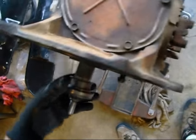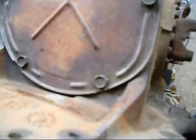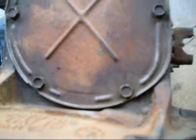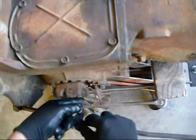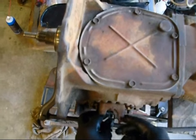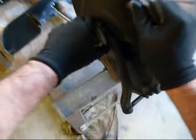So what we're gonna do, put that thing on there like that, and we're gonna line it up. You gotta kinda get tricky with it and push the spring thing in with both fingers. And we missed one, because I got gloves on. There we go. Okay, we've got both our spring fingers down inside the throw-out bearing. Got our little guy on there like that. I'm gonna wire this up here so it doesn't flop around on me. A little piece of wire. Keep it in place, and then I'm gonna mate these suckers back together now.